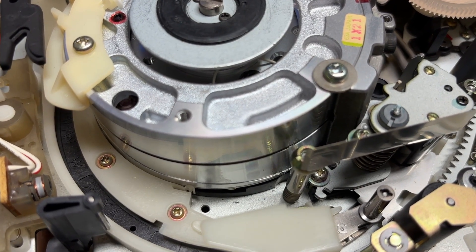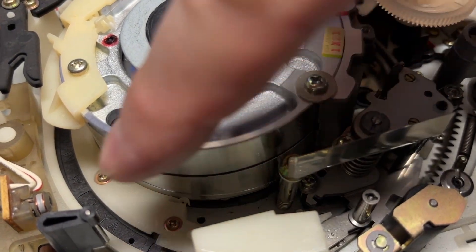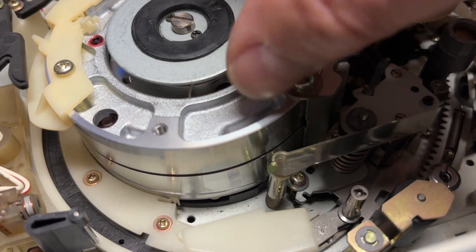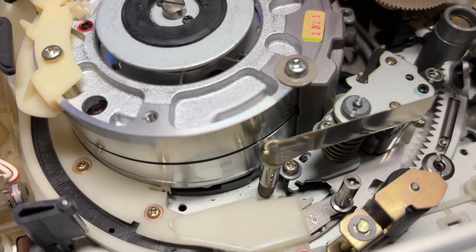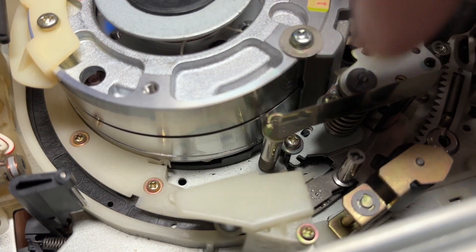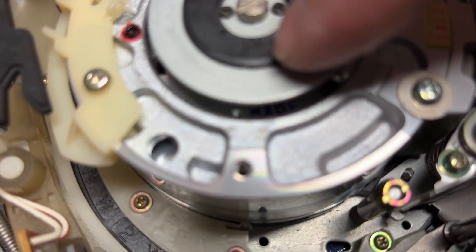My video heads are now clean. What I did is I used one of these alcohol prep pads and just held it up against this section here. The interesting thing about the way this video head is designed is that the whole thing is stationary. Like on a VHS VCR the whole head spins, but in this case the outside — top and bottom, divided by that crack line there — doesn't move. But the video heads on the inside are what's moving.